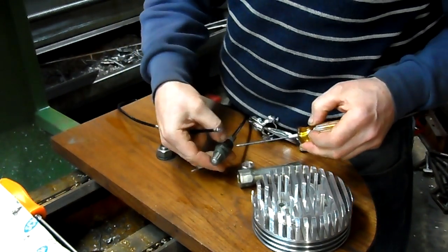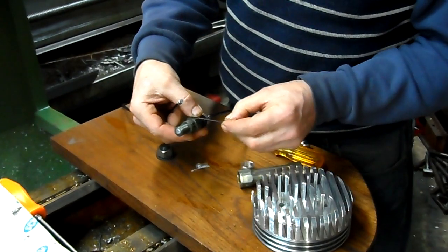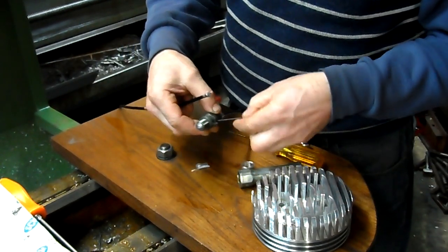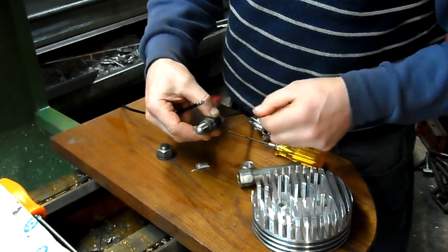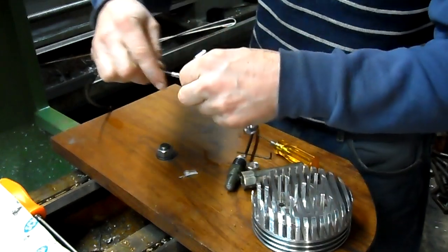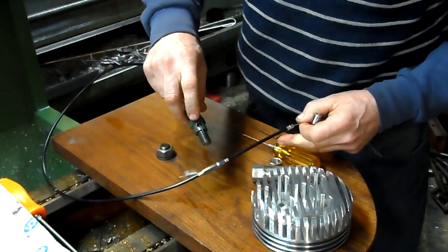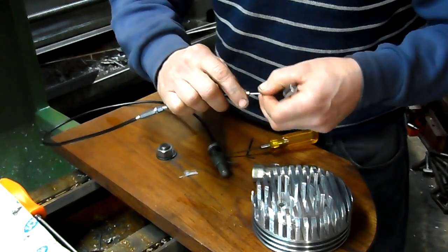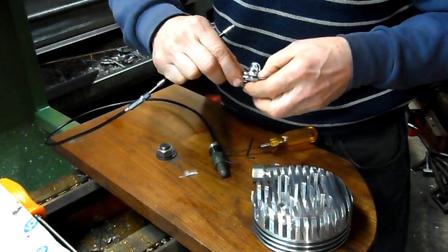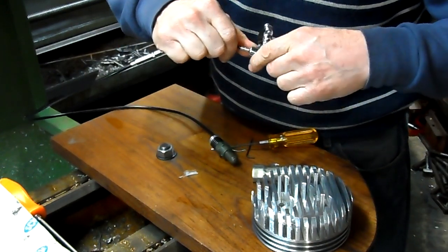This adjustment here is correct. Now tighten the valve — I'm just going to snug it up just a little bit. I'm going to double-check to make sure that this adjustment is right, because once you tighten this screw down hard, you're going to mash the cable a little bit and it's going to make further adjustment in the future a little more difficult. So to minimize those difficulties...